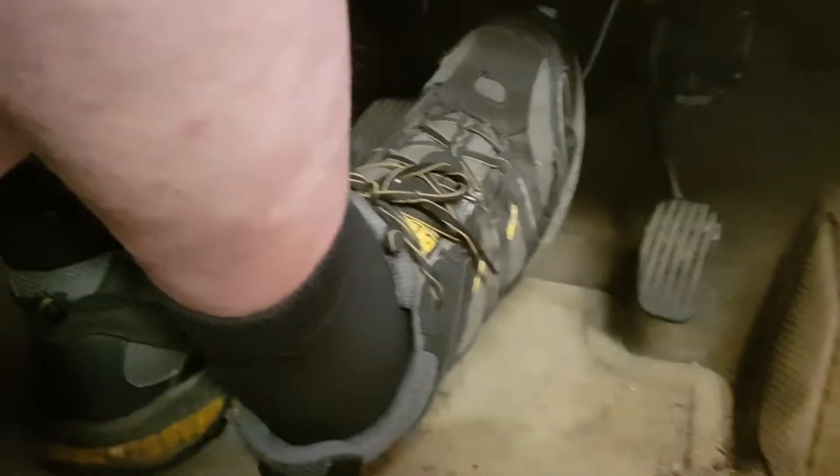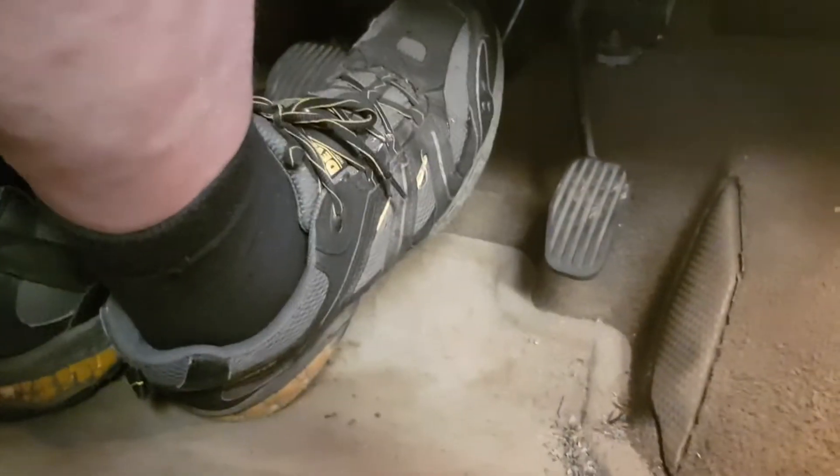What we're here to do today is to check the Bravo brake pedal creep. If I come in under here like this, with the engine not running, it creeps away. It seems to sort of get to the bottom stage of the master cylinder and it stays. The brakes still work, the ABS still cuts in, but look at the travel on that brake - it's terrible.